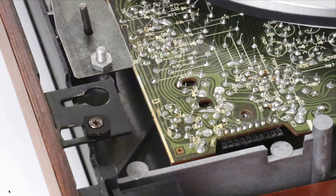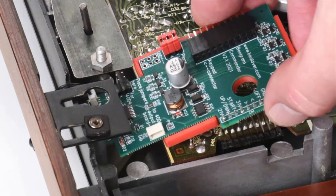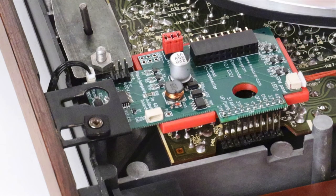Now it's finally time to place the commander board. One important aspect is that the infrared remote receiver is fed through this gap here, between these two metal parts on the plinth. The other point is that the commander board goes underneath the fixture here that holds down the aluminum panel. The header on the commander board must line up exactly with the jack on the PCB — it is possible to plug the board in one position too far right or left, but you would immediately notice because the screw hole would not be centered underneath the opening in the commander board.